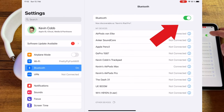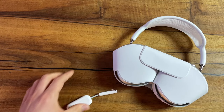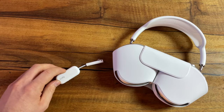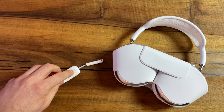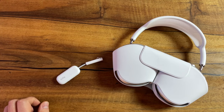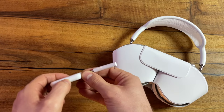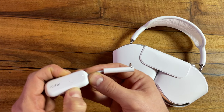You need to turn off Bluetooth on all Apple devices nearby and place the AirPods Max in their infamous case. Make sure your AirFly is set to TX mode. To be on the safe side, reset the AirFly by holding the big button for 4 seconds to turn it on, and then holding the small button on the side for 4 seconds.